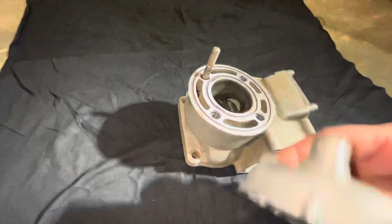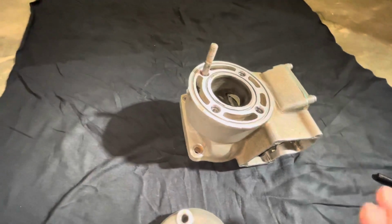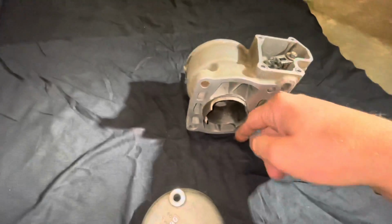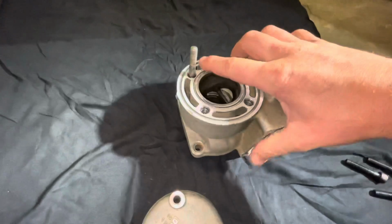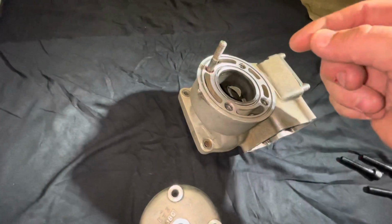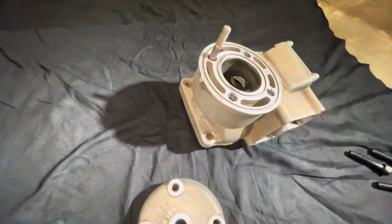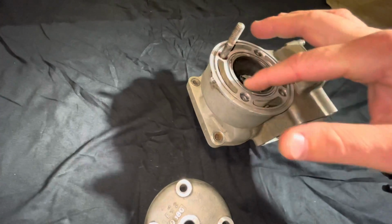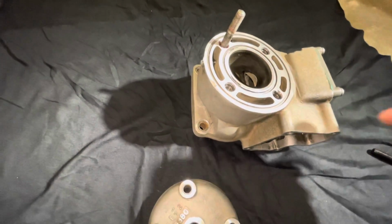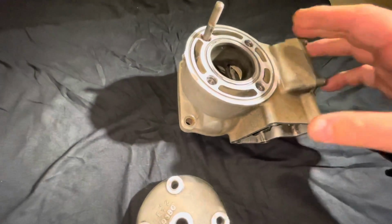So what I had to do was make sure this surface is decked and clean and 100% true to this head surface. I pulled this stud off, and I went with a fly cutter on a milling machine. I set it up this way, clamped it on these points right here on each side, and I put blocks under here and raised it up and clamped it down to the table, and went with the fly cutter so that it will cover the whole surface with a carbide tip, and it removed all this material at once, so there wouldn't be any steps. And the center point is steel, so I couldn't just use high-speed steel, so I had to use a carbide, and it removed everything perfectly. It went that way, then it came back and it cleaned up pretty good.